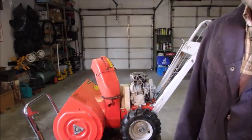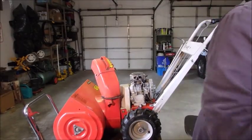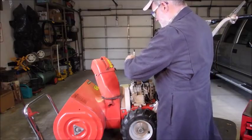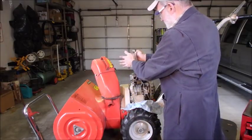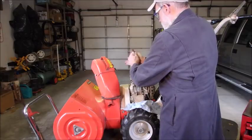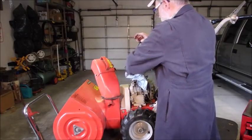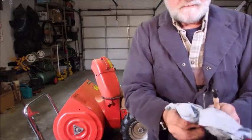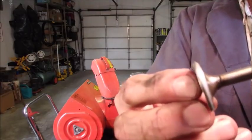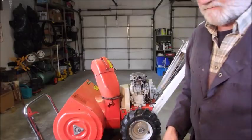Good, and I'll just do that with the exhaust one after I grind it — I'll be back in a bit. Hope you guys saw some of that. Anyway, these actually look really good, so now I can take that out and we'll see what kind of an edge we have on there, and I'm going to clean everything up before I can put it back together. If you look really carefully, there's a nice gray edge all the way around. Good. Now the exhaust valve.